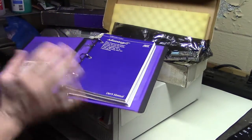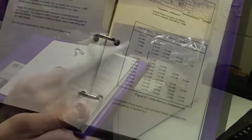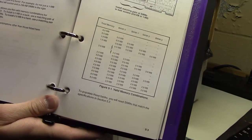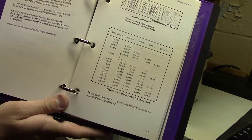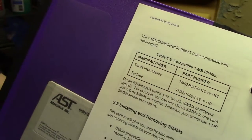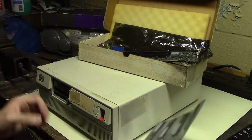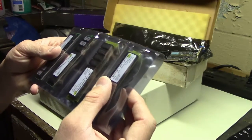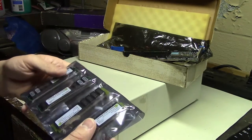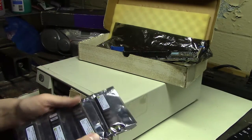The manual was actually just some pages with holes in them but did not come with a binder. According to the manual for the Advantage 2, you can only install 256k sticks or 1 meg sticks of RAM and they have to be paired, so you add RAM in banks of 512k or 2 megs. The manual also lists manufacturers and even part numbers of compatible RAM. I found some Toshiba sticks online - THM9100AS-10 - but the manual only lists ones that say S-10 without the A. They are 100 nanosecond sticks, which is what the board expects, so I'm going to put these in and see what happens.